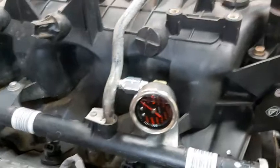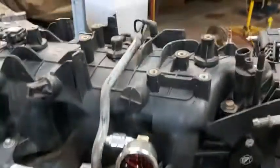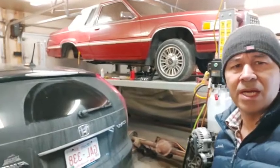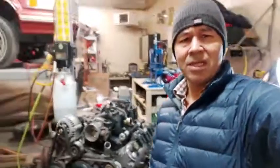That's all I did here — took the Schrader valve out of the factory rail and put our pressure gauge in. That's 100 PSI from VMS Racing. That concludes another video guys, thanks for watching. We just installed that pressure gauge on the fuel rail, and we'll hopefully continue work on the T-Bird. I plan on putting the rear end in before I go to Vegas here shortly. Thanks for watching, hope you learned something.